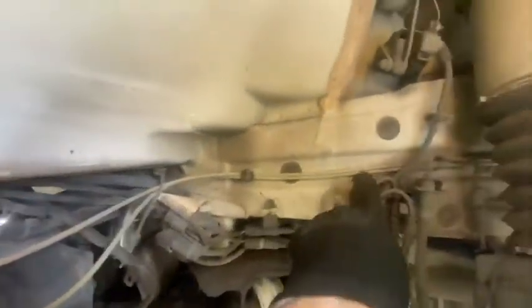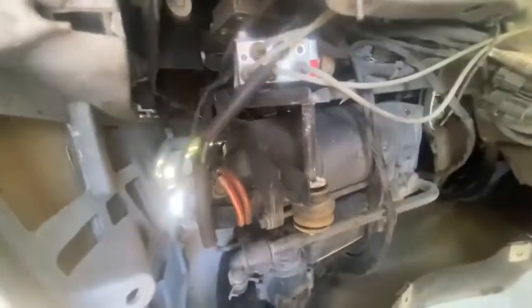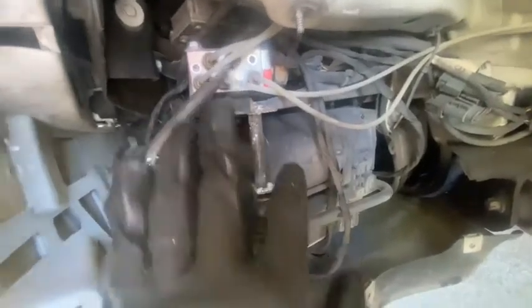So we've got the fender liner off. Here's our valve block — she's only a little valve block right there. If you see the valve block in my S600, it's like the size of this pump, like a big hydraulic tractor one. Anyway, we've got our airmatic here, we've got our lines that run to the back axle rear reservoir, and we've also got our lines that run to the left and right strut, and the one that connects to the actual compressor. So we're going to pull the negatives off and then take this sucker out.